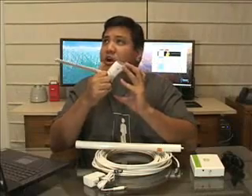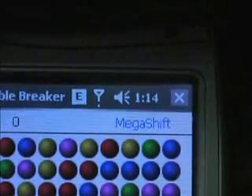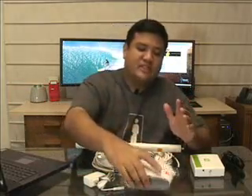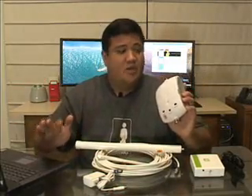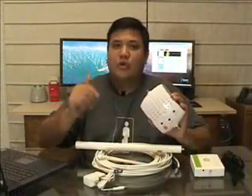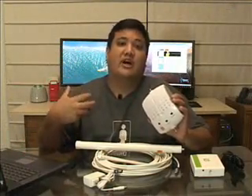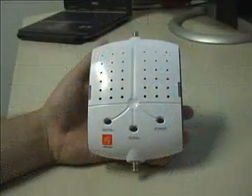In our test, we were using our location here, which honestly is not quite good enough for my T-Mobile service. If I go 10 feet in one direction, I've got great service. But in this office or up at the house, I was getting maybe one bar. Most of the time I would drop calls, every other call I couldn't connect, and anyone trying to call me would almost certainly get my voicemail because it just would never ring my phone. When we plugged in the ZBoost, that changed entirely. For the duration of the test, I never dropped a call, every call got through to me, the sound quality improved dramatically, and my battery life increased — probably because my phone doesn't have to transmit at such high power to get back to the repeater. This unit was doing all the work.